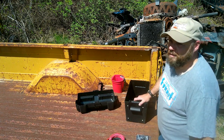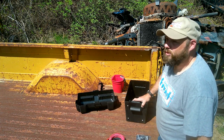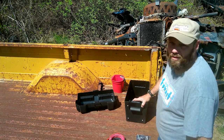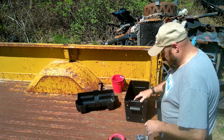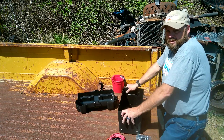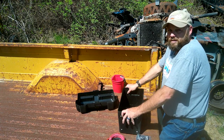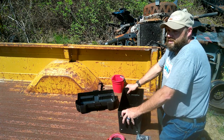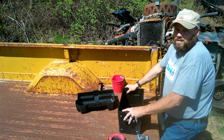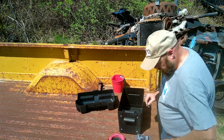So it should work just fine. When I tested the plug on the back of my truck it was putting out 12.3 not running and I think 13.3 with it running. So no problems there — 13.5 I think is minimum to charge a battery. So if you just wanted to run this right off of your truck, it really wouldn't work. You might get a little bit of a charge, it would never keep it up. This thing also knows when it's full — it turns on, turns off — it's like a smart charger. So better system.